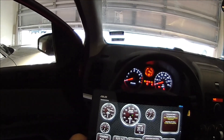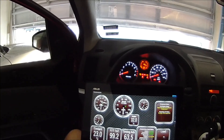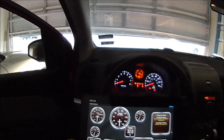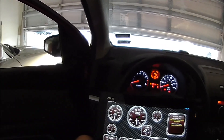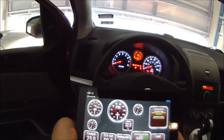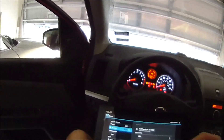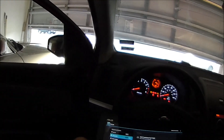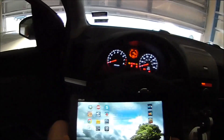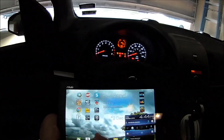We're connected — it's showing all my current drive cycle status and that fun stuff. If I start the car I'll start getting feedback from all the other sensors and all the information the ECU can provide. So to recap the sequence: delete the paired device, close out of Torque, connect your interface to the car, put the ignition switch in the on position if you're not getting power, then check that Bluetooth shows the OBD2 interface as an available device, and only then open Torque. This is on Jellybean 4.1, so your mileage may vary with a different version of Android.